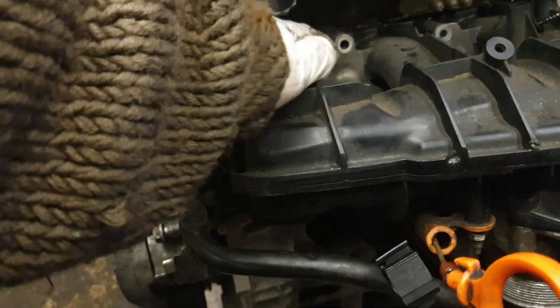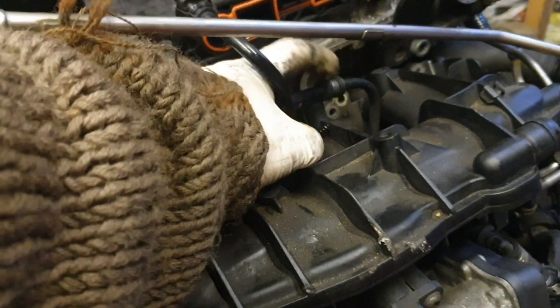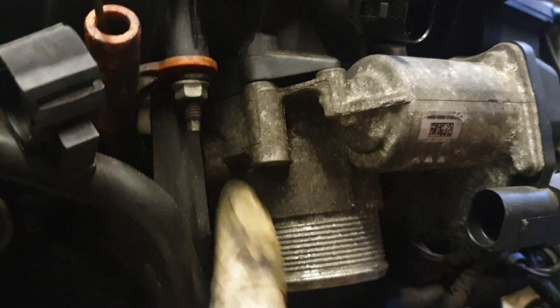When you get to the intake manifold, you have to remove the T-30s - there, there, there, there, a few here, one at the back there - and then there are a few more bolts to get from underneath. To tackle this, I'm going to remove the throttle; there are four T-30s holding it and one at the back that's been blocked off by this pipe. So I'm simply going to remove these two hex 5s, take out this whole thermostat with the pipe, remove all of that piping, and then get access to the last couple of bolts underneath to remove that intake manifold.